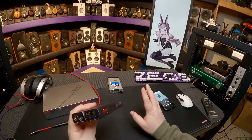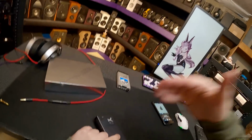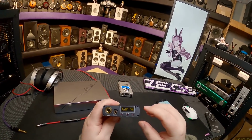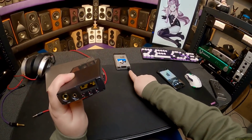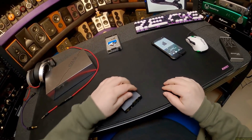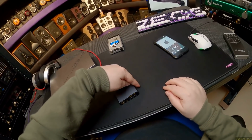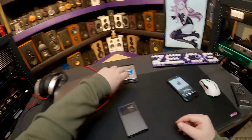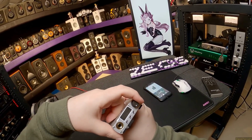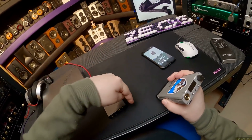There's a couple of peeves. I've already told you, it sounds better than the old one. The Bluetooth is built in, LDAC Bluetooth is built in. The range is bad, we'll get to the range. When they pushed the volume knob into the unit, they didn't reverse its direction. So when you put this down and go to make it louder, you would think you would lift up like this, but all they did was internalize this knob. So when you lift up, that's turning it down. You push down to go up.